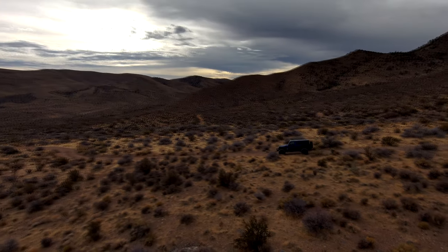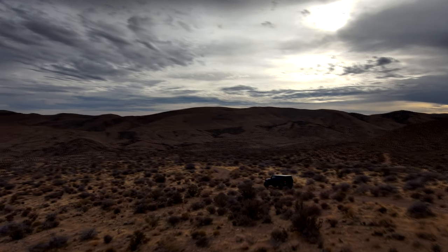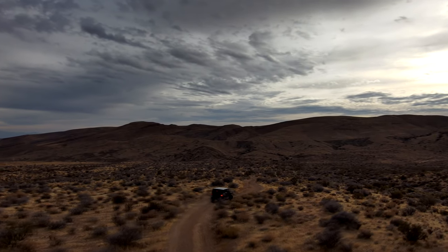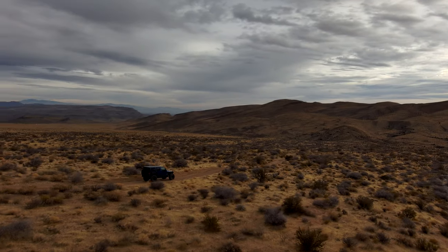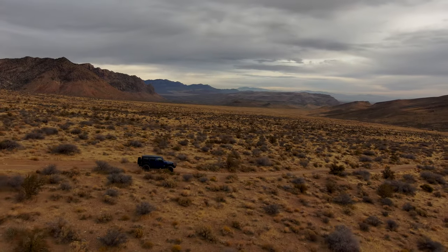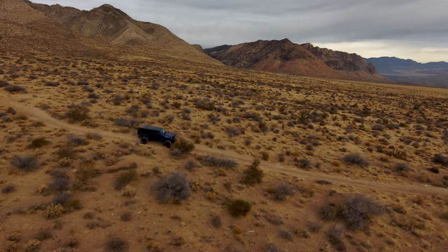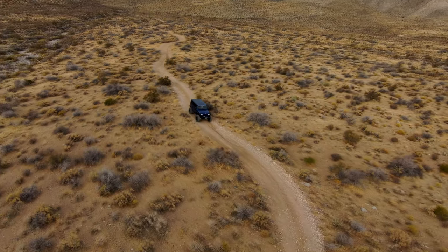So, like I said, the air conditioning, cruise control, tap shift, it's all working right through the GM system as GM intended it. We're not overlaying it, we're not patching it, we're not hacking it, we're not trying to put a GM into a hybrid situation where you're using a Chrysler transmission. It's just simply running exactly the way it was intended to by the manufacturer. And then it has this bi-directional bridge that we call our single module system that makes the two sides talk to each other so that we get the functionality that we want on the Jeep side.